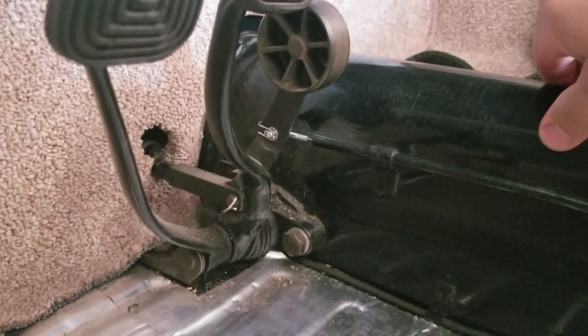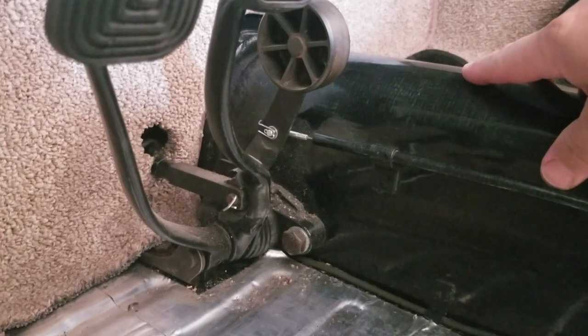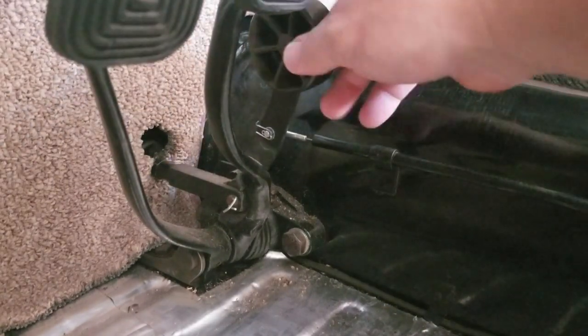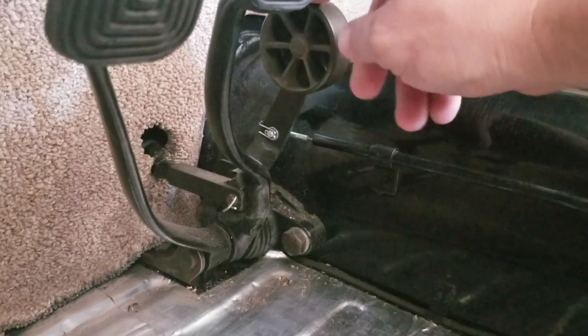And it could be the springs back with the carburetors just aren't strong enough to pull the pedal all the way back every time. So it could be that too. And I've got a plan on that. I was going to go by AutoZone today and see if I can get a beefier spring for my carburetors, and maybe come up with some sort of linkage to improve that.